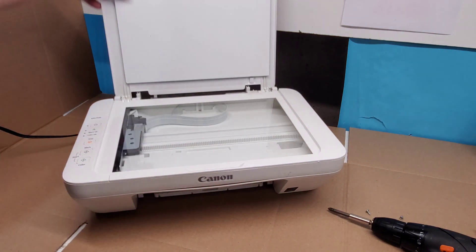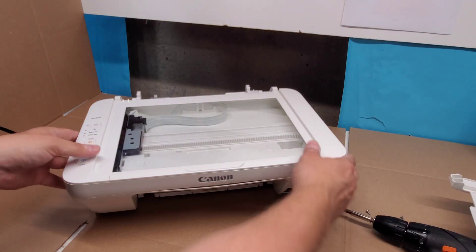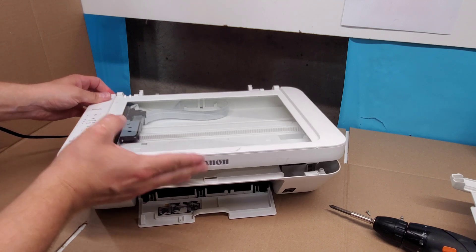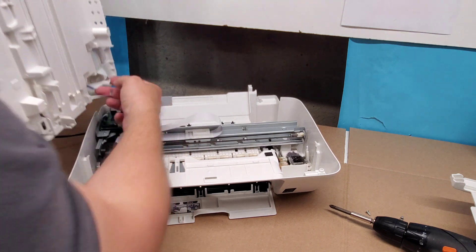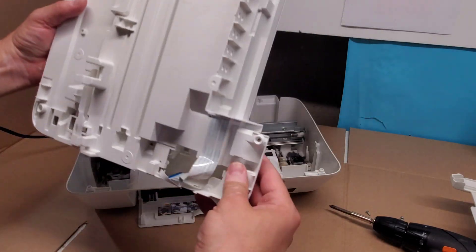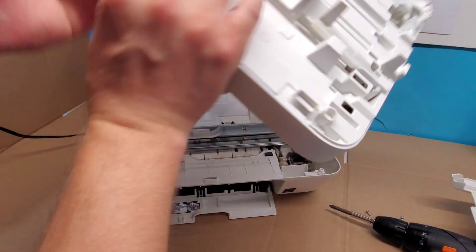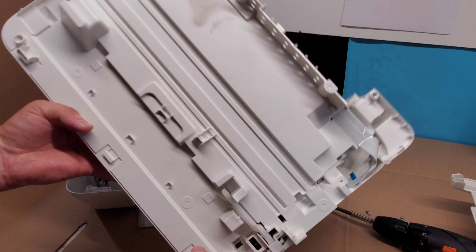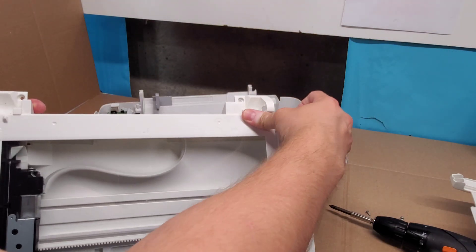That was a video showing how to get access inside the printer. But to take some other parts off, this just comes out like so. Then we already have the screws removed — pull it back gently, pull it back, and disconnect the two wires like we did: this main one and the little one for the control panel. There's also what I think is glued on here, so it's a bit hard to get to the scanner unit. On these budget printers, that's usually how it's going to be.